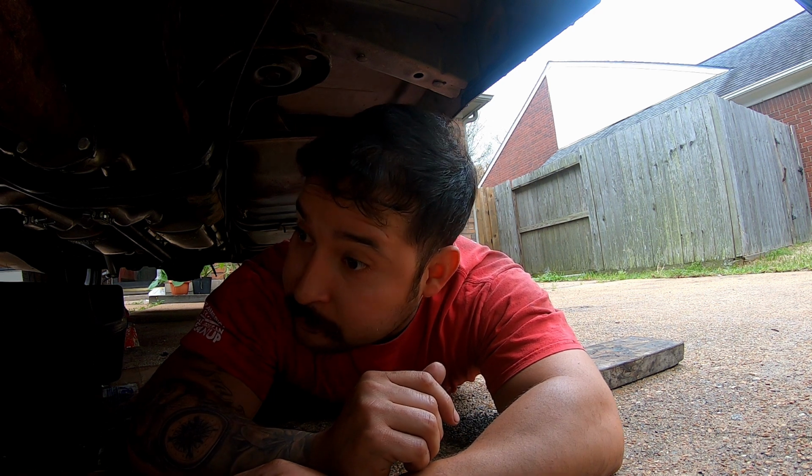Hell yeah, I'm going to call that a success. I ended up adding just another small thin shim on that same side towards the passenger side, because there was a little too much play. The more I played with it and shimmied that 1/8 inch Allen wrench in there, I didn't really like it. I went ahead and added that extra little thin shim. I can't remember what it was. It was probably 30 thousandths or something.